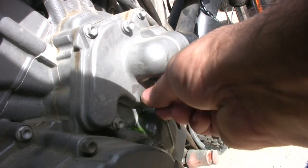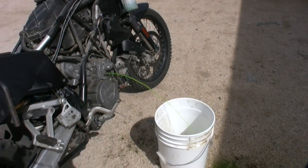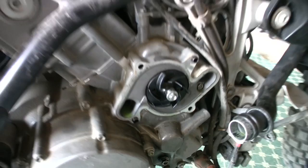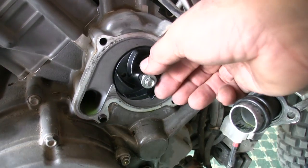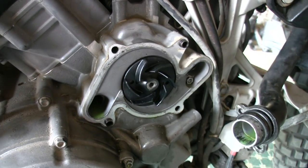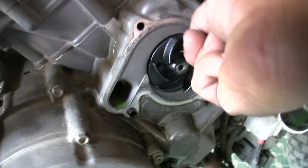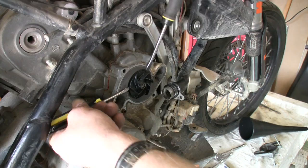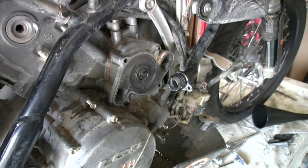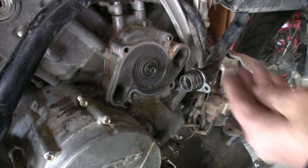Take this little screw out and it pees right out. The inner cover. Apparently you need a special tool for this, but I was able to hold it and loosen the impeller bolt, so I kind of lucked out - I guess it's a KTM tool. Maybe I can pull it out real easy. So we're destroying this to get it off because we have a replacement. Not recommended to do it this way, but again we have a replacement. There we go - don't lose this, unless you've got a new one. I think the kit comes with a new one, right? Yeah.